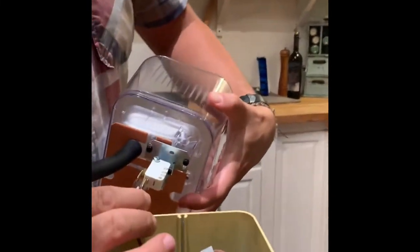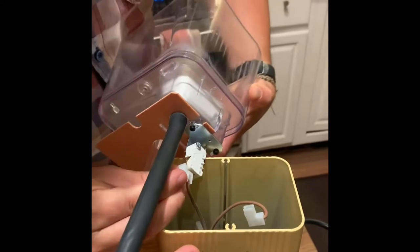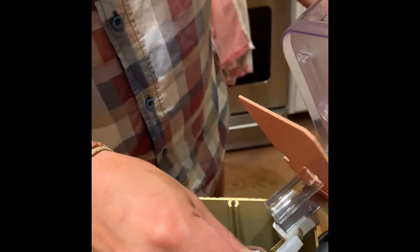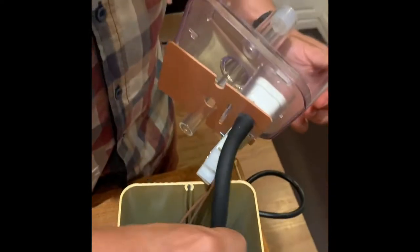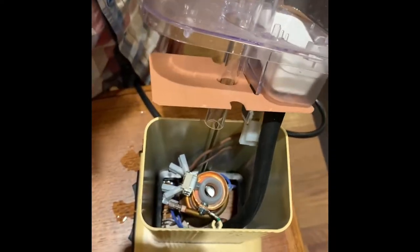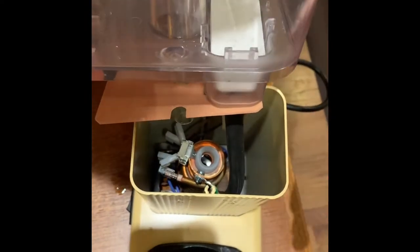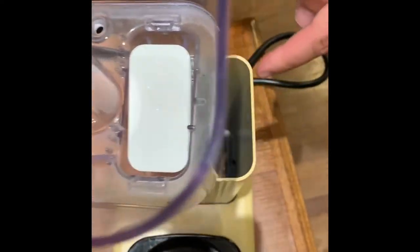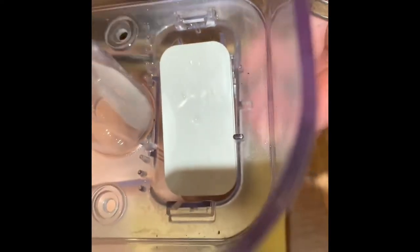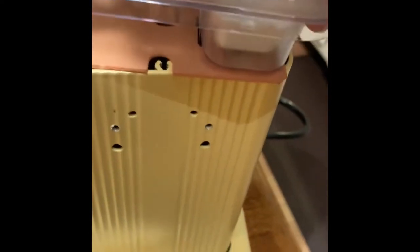Put the switch back where it should go. The contacts are friction contacts — just push them back in, nothing special. Then bend the tube and attach it back on the left side of the machine looking from the back. Make sure as you push everything down, that rubber hose is going to go next to the heating element.